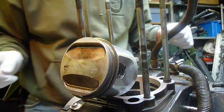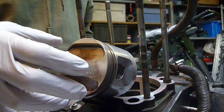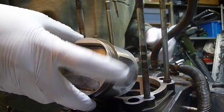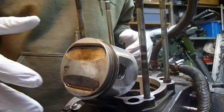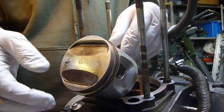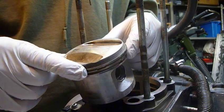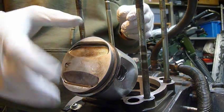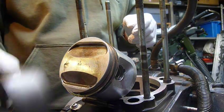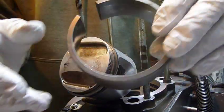This is a quick tutorial on a really easy way to put the piston back in the cylinder and reassemble it, without having taken the piston off the conrod — avoiding all the pain involved in trying to insert a piston in a cylinder with the rings one by one. Rotax came up with this tool: a piston ring spanner, which looks like it's been honed out of an old piston liner.